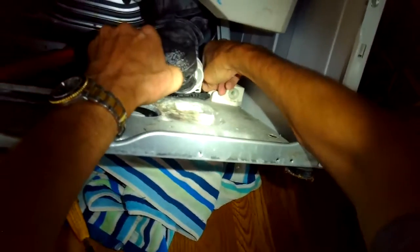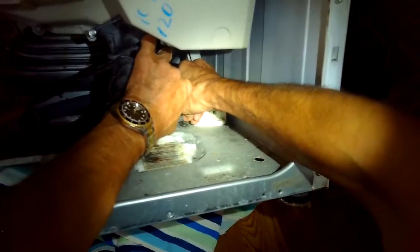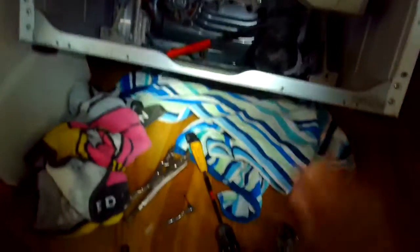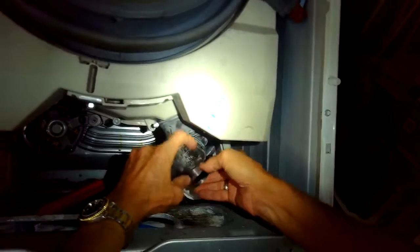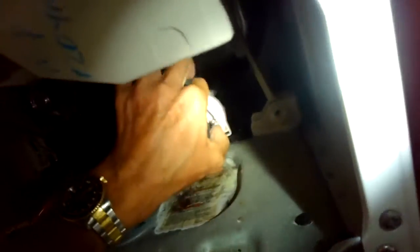I'll pivot the pump over into position, put the Phillips head screw in on the right-hand side, and get that tight. Then I'll bring the hose clamp back over the black tube, put it back onto the drain pump, and tighten up that hose clamp — I really like using those instead of the spring clamps. And that did the trick — I got it spinning and draining properly. Hope that's helped you. Please subscribe when you get a chance. Thanks for watching.